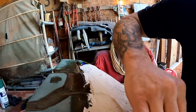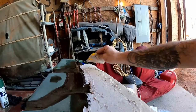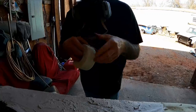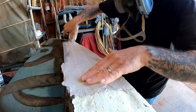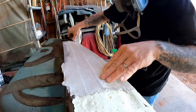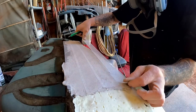What I think I'm going to do is break this in half — do half now and then half with our next wipe, because we're going to run out of work time otherwise. Once we get to this point, we're going to switch over to our drywall tape. We've got our drywall tape — let's get this stuck on here. We're going to do this while that mud is still wet. It's okay if it overlaps — not a problem at all. I cannot stress this enough: you've got to do this while the mud is still wet. Otherwise this step will not do you any good. We need that tape to be embedded into the filler — it's very important.